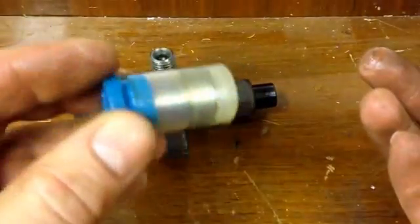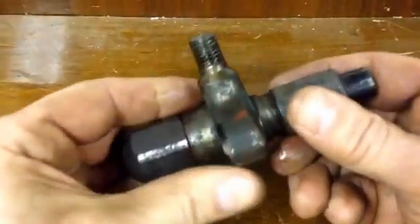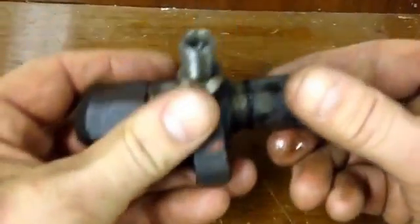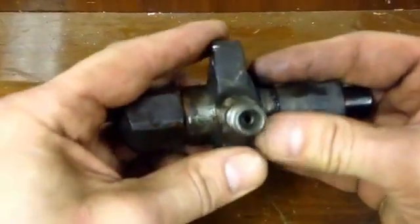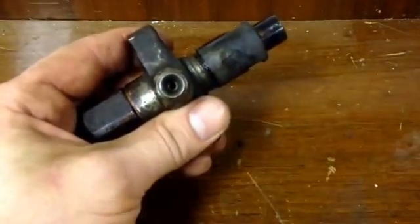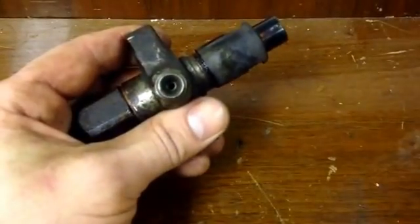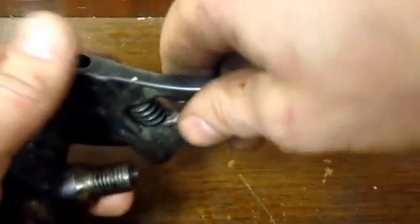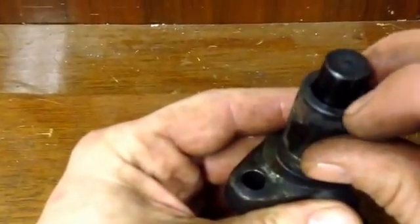You can just buy new nozzles and stick them in — I'll show you how to do that. By rights you should then adjust them to set them up correctly, but in all honesty I've never had any problem just banging a new nozzle in. I'll show you how to do it yourself without having to buy one of those, which is 26-odd quid. The tricky bit is always going to be getting this off. What you've got here covers the adjuster — that there is the adjuster that adjusts the pressure the injector opens at. Get it in the vice, warm the outer sheath with a blow lamp — not red hot, just until you can see the old muck bubble slightly — then get a set of grips or a spanner and give it a tap with a hammer to free it up.